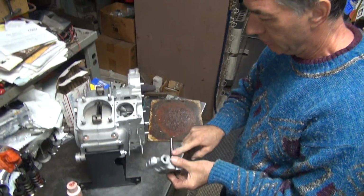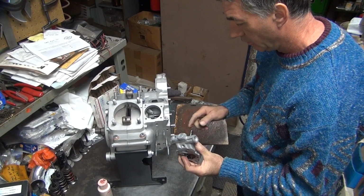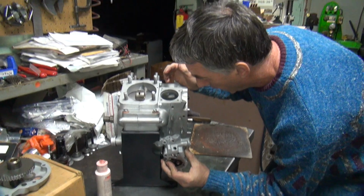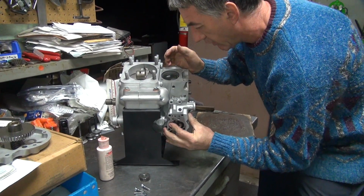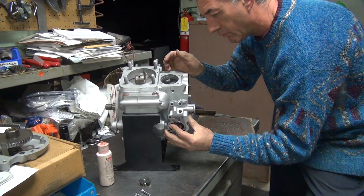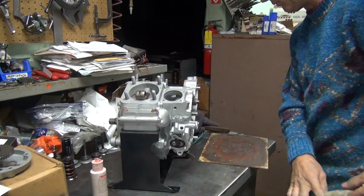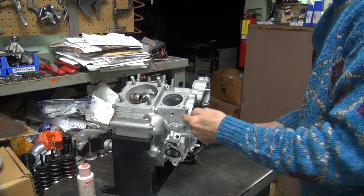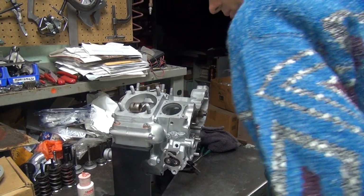All right. Rotate if we can get to the keyway. All of this stuff is kind of time sensitive. Gasket is being held by the pump flat so it doesn't tear. You can try to put the gasket on the block first, but it would want to tear and wrinkle, and you'll probably tear it before you got it all the way on.